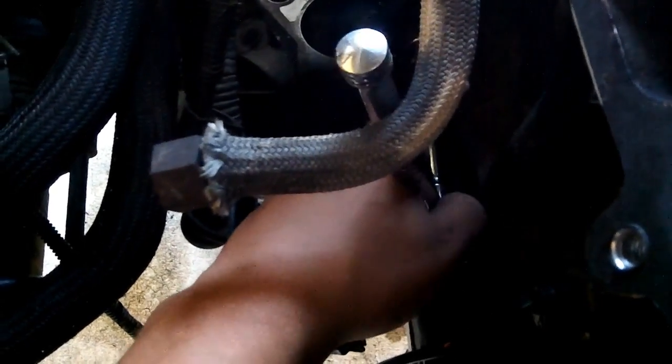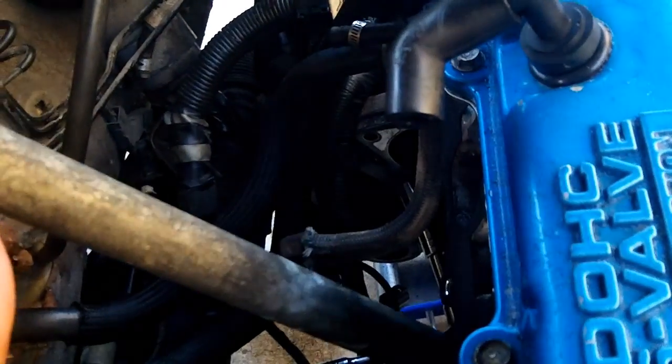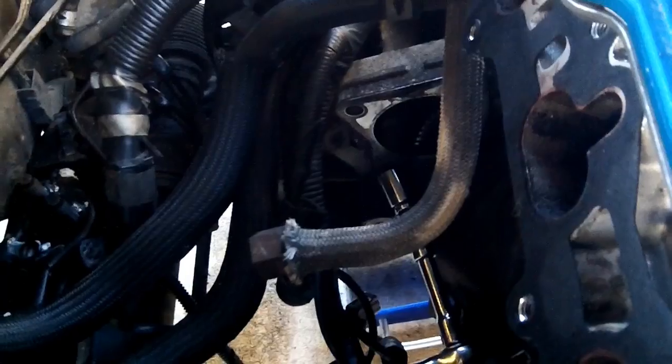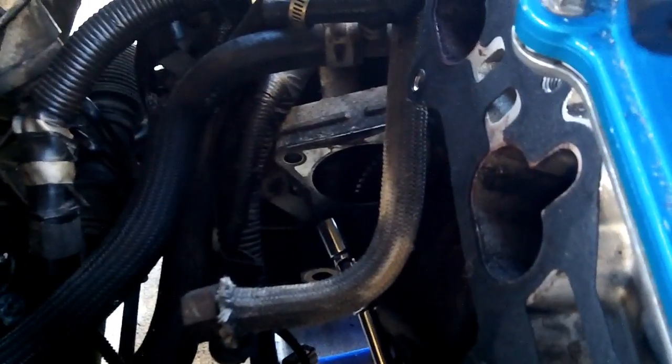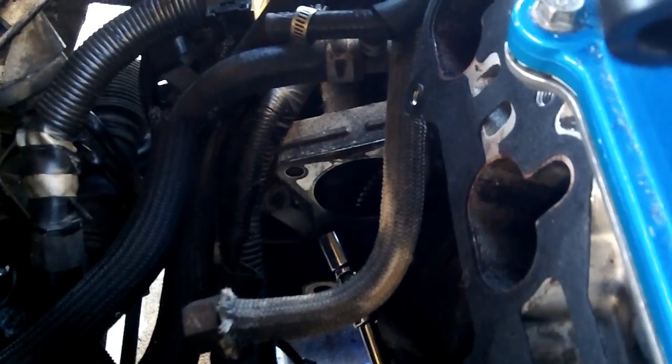And then I took this, went straight up with it. Then I put my breaker extension on it so that I got the leverage and cracked it loose. But this one was probably the second hardest to the rear mount bolts. These things are on there good, probably because the entire weight of the transmission is just resting on those 4 bolts.